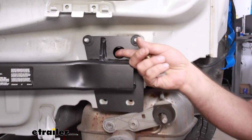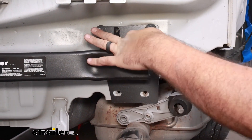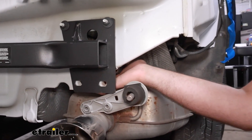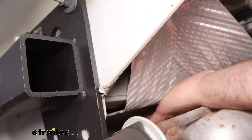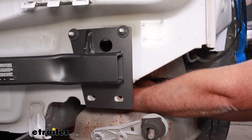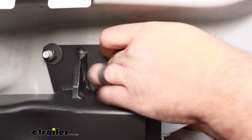We need to fish the hardware through this access hole — make sure any sticker on this spot is removed so you can pass things through. We're going to take the coiled section of our pull wire; there's a hole right behind the heat shield and another one back here. Make sure the hitch is aligned, pass your finger through to confirm, then feed the coiled end through the access hole and pass it up to the hole above.